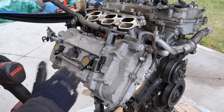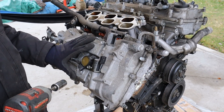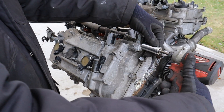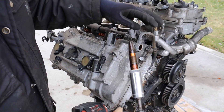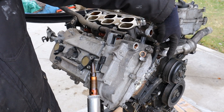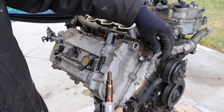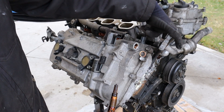The first thing we're going to do is remove the rear valve cover. This bank actually faces the firewall and I think that's where the damage is. First I'm going to remove this hard line for the VVTi gear. The filter looks pretty clogged. Now this rubber piece on this line was subjected to a recall because it would burst and the engine would lose oil pressure and supposedly stall.